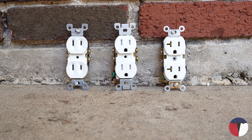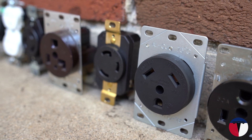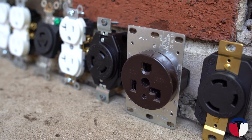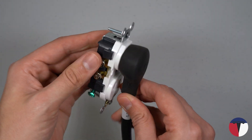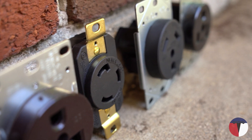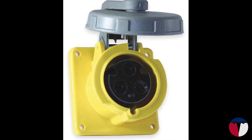That pretty much covers all the common 120-volt outlets used in North America, and some of the weirder ones as well. A lot of these adapters are going to be highly specific to what outlets you have available, and I don't expect many to work as viable options for most people. I do, however, suggest purchasing a NEMA 5-20 adapter from Tesla. At only $35, you can charge your Tesla 33% faster in a pinch if you don't have a high-output receptacle or a charger available. I covered most every 120-volt NEMA outlet, but there are some other proprietary outlets out there like this Unicorn 120-volt 60-amp. If I forgot one that you'd like to see me review, let me know.